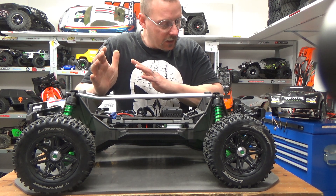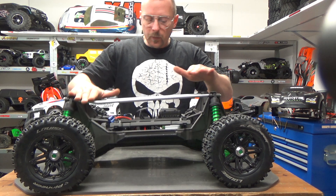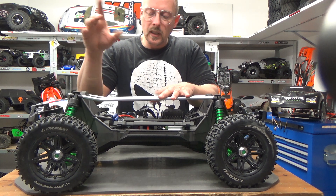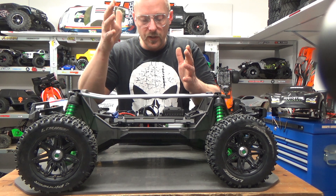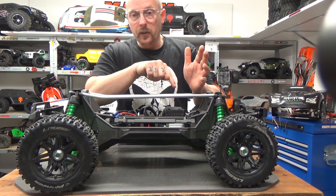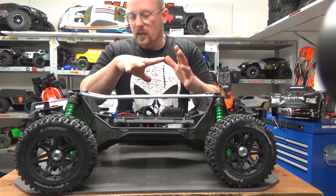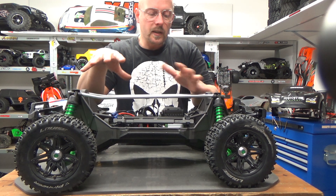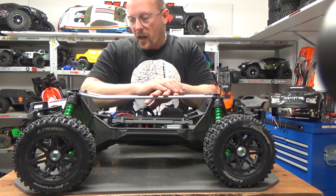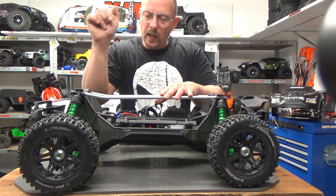I have the stock shocks with the spring let all the way down so I'm not too high. I will drive it in the field and on the road. For the road I'll use SC Rocket or MCD R5 tires — we already did it. The Street X-Max had a 46 main gear and 22 pinion and we drove it at 90 kilometers per hour with those tires on road. It was really fun because the truck is not heavy. With MCD tires and 8S batteries it weighs only nine kilograms, and on road it was just fine with good ground clearance.